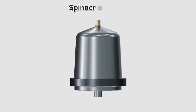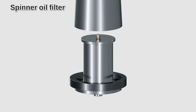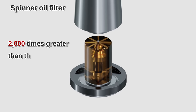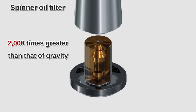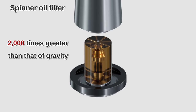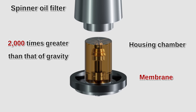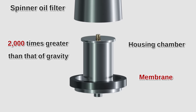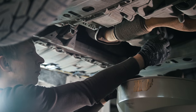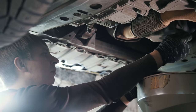One type of secondary filter is the spinner oil filter, also known as the centrifugal oil filter. As the name suggests, it spins — generating centrifugal forces up to 2,000 times greater than gravity. That's why it can efficiently trap some of the tiniest contaminants from the motor oil. These filters typically have two sections: a housing chamber and membrane. A critical part is the base gasket, which prevents motor oil from leaking, but it's also one of the weakest parts. Be sure to check the base gasket at least once every three months or every 3,000 miles.